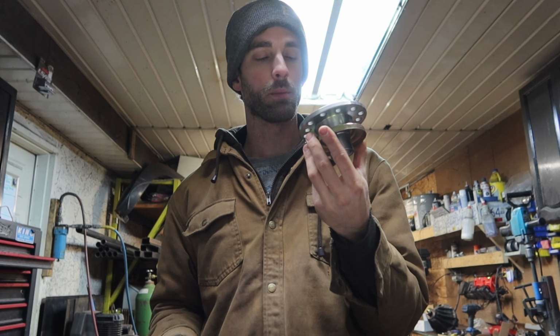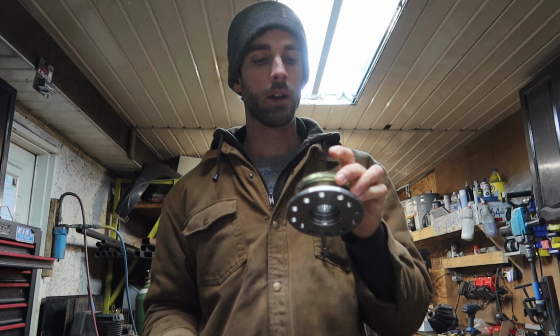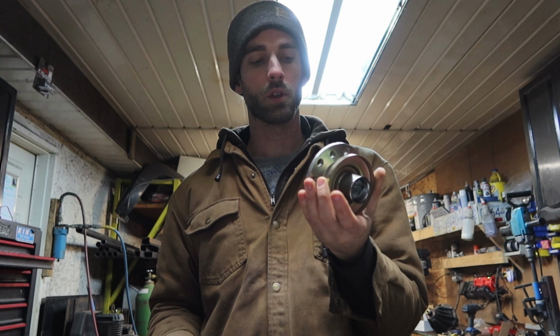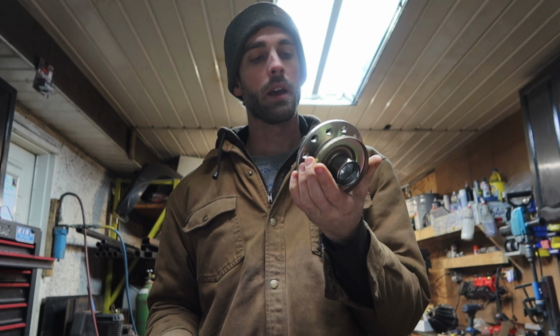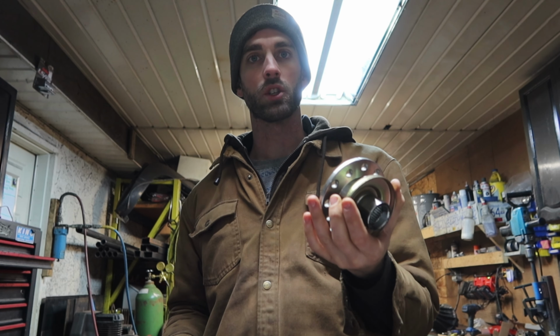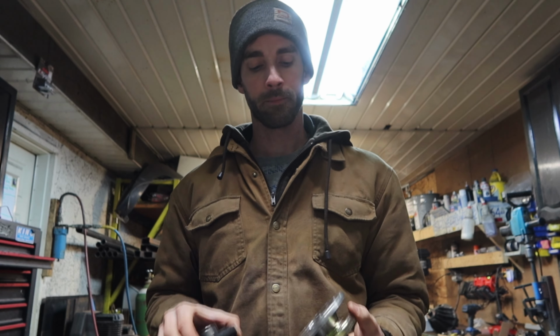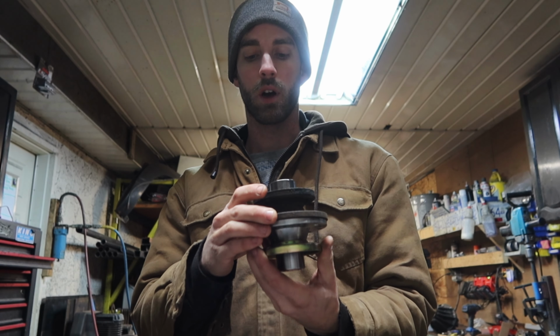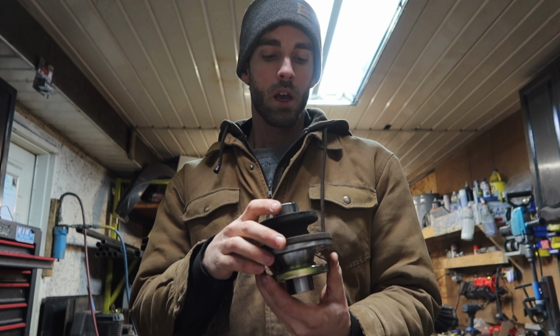This is the triple drilled pinion flange that I bought. It's Trail Gear. It's 27 spline, so it's supposed to go up to the 4-cylinder diff and allow me to mate up a V6 drive shaft. It doesn't. The bolt holes, all 4 bolt holes, do not align properly.